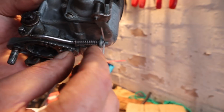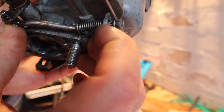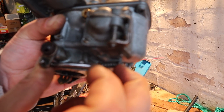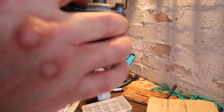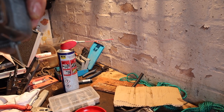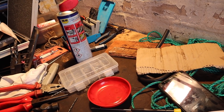What we've just noticed is that on the pump rod — I've got a pump spring back — the pump rod has two holes in it and we've only gone on the latest hole. I think if we pull that in and put the pin through the earlier hole, we'll potentially get a bigger stroke. This is the pump stroke. Leave the original in, turn the spring back, put another pin through but don't bend it — so it's going to hold the spring there. Then we haven't got to remove this in case we don't need it.